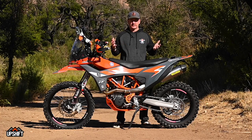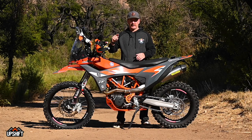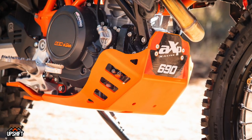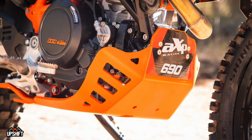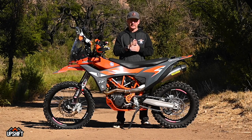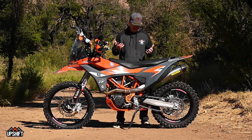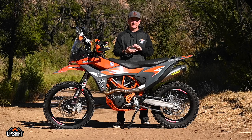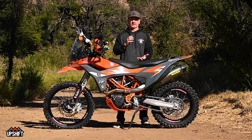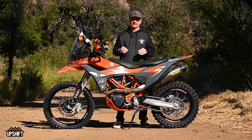These bikes are expensive — you don't want to drop them or smash a rock through the case. This bike runs an AXP skid plate, a poly skid plate that's a high-tech plastic mix offering more sliding. If you land on something it'll take a gouge rather than crack, and it runs under the linkage so a rock spitting up won't smash the knuckle on your rear shock. Rottweiler Performance also makes dongles for overriding your settings — this bike has an ABS dongle, fuel dongle, and kickstand dongle.